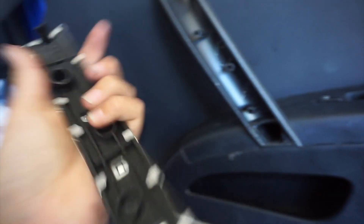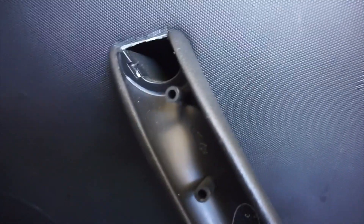Moving to the mirror on the passenger side, you have to take this trim piece out — I'm just using a flathead. You do risk breaking things so be careful. There we go, doesn't look like anything broke — yay me. Then there are some bolts in there in secret hiding spots — one back there and one back there. Part one done.